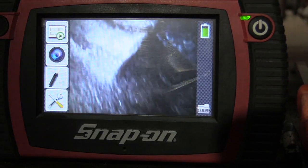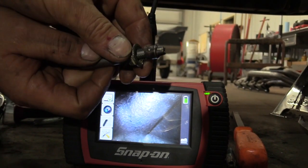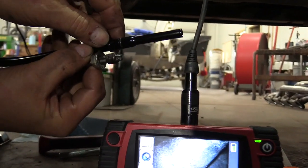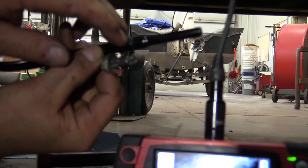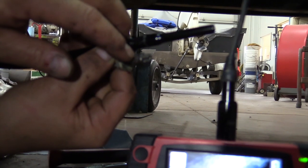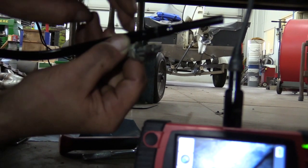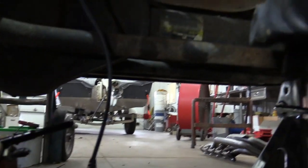This is my first time through on this, and in hindsight, if you take a look at this tap — this is what we got that top section out with. There's the new dipstick, and there's a real thin spot where that O-ring goes. What I did is I threaded it in a little bit too far and it split right there where that O-ring was. So in hindsight, what I would do different is I would only run that tap in maybe halfway, instead of going as far as I did. Because if I'd gone in maybe halfway, I could have gotten that whole tube out. As it is, this section of the tube has fallen down and it's right here in the bottom of the pan.